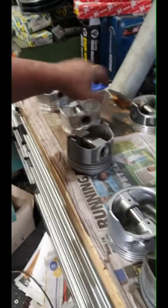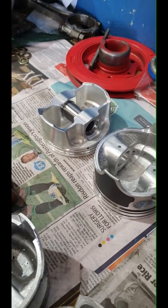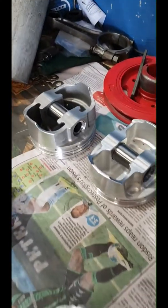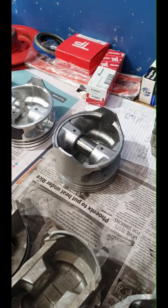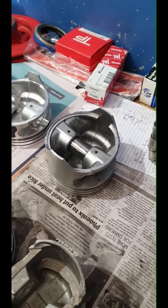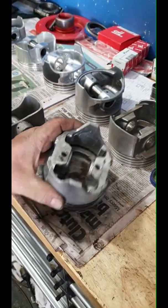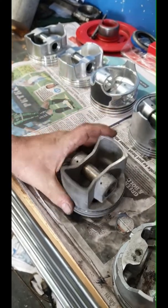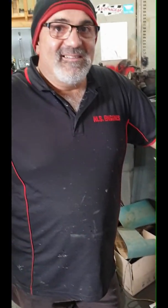What do you use for a race? We're going to use this - the full race piston. I'm going to go mad at the quarter mile, thrash the living Christ out of it, and then park the car and do it again one month later. And this one - we drive it on the weekend only. This one - we drive it every day, go to work, park it at the train station, pick up groceries. This one is the same. This one - junk. I say to people stop putting forged pistons in if you use them only for the street - not good mate, but they do last very long.